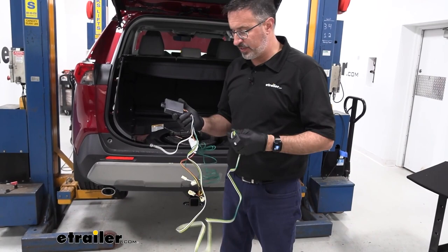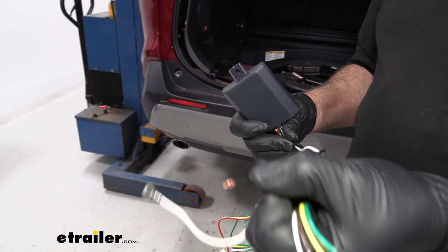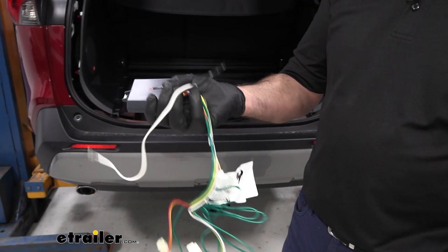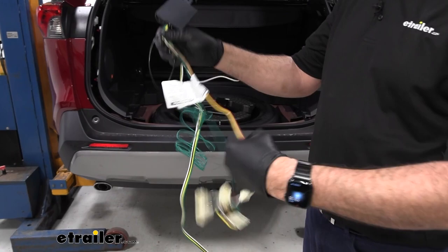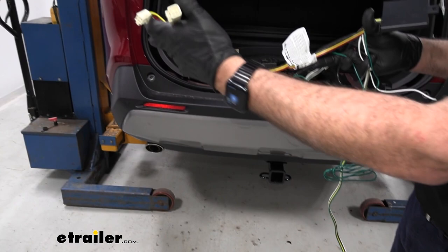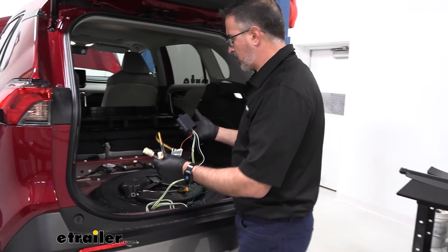Let's take a quick look at the harness before we install it. On here you're going to have a black and a white wire. The black wire is going to be a positive 12-volt from our battery up in the front of the car — we're going to be running that line later in the video. The white with the ring terminal is going to be a ground, and we'll ground it back here with the supplied sheet metal screw. You're also going to have your four-way flat connector — this can get stored in your trunk or you can run it down below. Then you're going to have the connections for your driver's side: the red, brown, and yellow wire. This will connect right to your factory harness up behind the panels. And then you have the passenger side wire which we're going to run along over here.